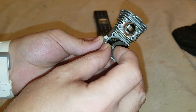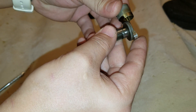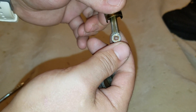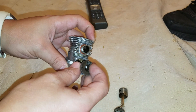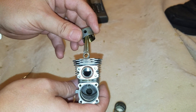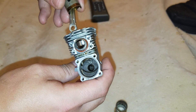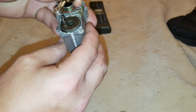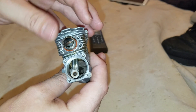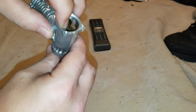You take the piston and put it in — this right here is where the piston connects to. You always want to make sure there's this little cutout right here. Always make sure — I believe that faces the exhaust. So you're going to put the crankshaft in, then take your piston rod assembly and put that in. It points that way because it has that cutout so the crankshaft doesn't hit the piston. Drop the piston rod assembly into it and get it onto that journal — it's so small it's actually pretty much just a pin.